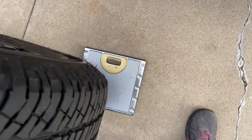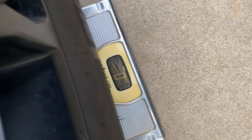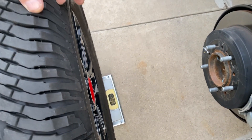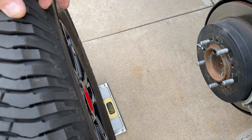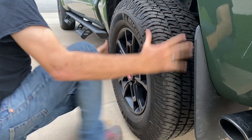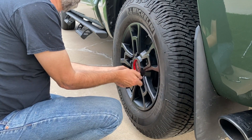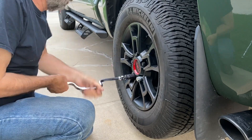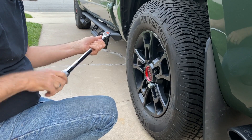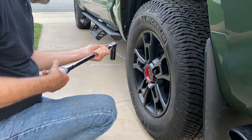One of the things I like to do is weigh the wheels and tires — I don't know why, I just got into the habit and now it's kind of my thing. 73.5 pounds. Just imagine what that would be if this wasn't a forged alloy wheel. Last thing to do — torque the wheels. 97 pound-feet. That's what they say with aluminum wheels, which isn't as much as you'd think, but that's why it pays to look.